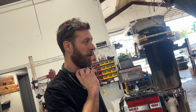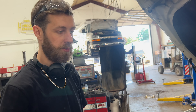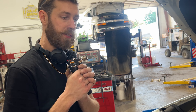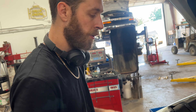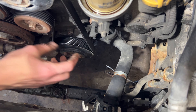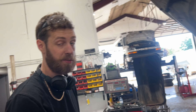This thing overheated, so I did change the thermostat as well. If you overheat, usually the wax sealed inside the thermostat expands so much that it leaks out and the thermostat is no good — it usually gets stuck open. To change it, it's located at the end of the rad hose that runs down to a housing, but to get that off you have to remove the exhaust manifold.